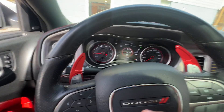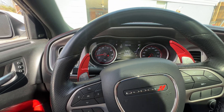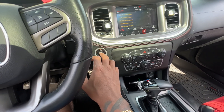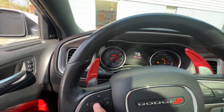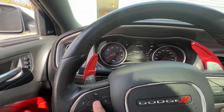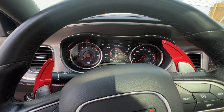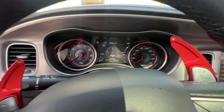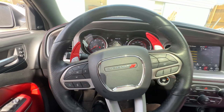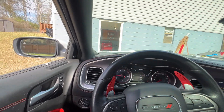To reset oil, the engine must be off — we need to be in run mode initially. So let me turn it off and put it in run. It should come up again. Now I can hold it to reset it. 100% — there we go. Fresh oil change. 100% on the oil. That was pretty easy, pretty simple. Now we're all good and ready to roll.